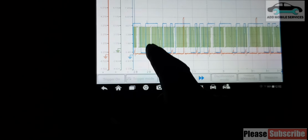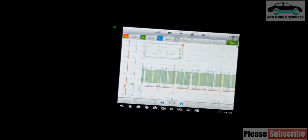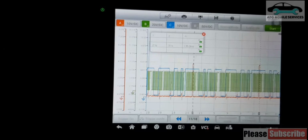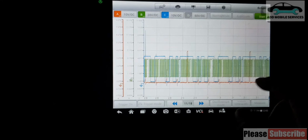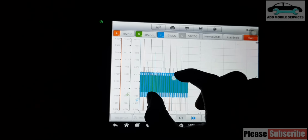The cam pattern starts from here, then you count. You start from the big profile, then count 1, 2, 3. Let me take a line here and measure from this side to this side. It jumped the timing and all the inlet valves, 12 valves, got bent. So I replaced the inlet valves and I overhauled it. Now I can also zoom it this way, zoom it whilst it is live.